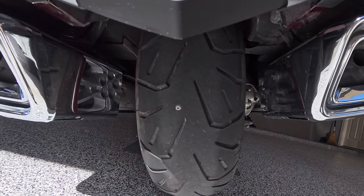I've been lucky — it's worked both times. One time it was almost in the sidewall, but I was able to plug it enough to get it to a dealer so I didn't have to pull the wheel off. The other time it was right in the middle of the tread. You really shouldn't plug a tire unless the screw, nail, or hole is in the center of the tread area, not on the sidewall.